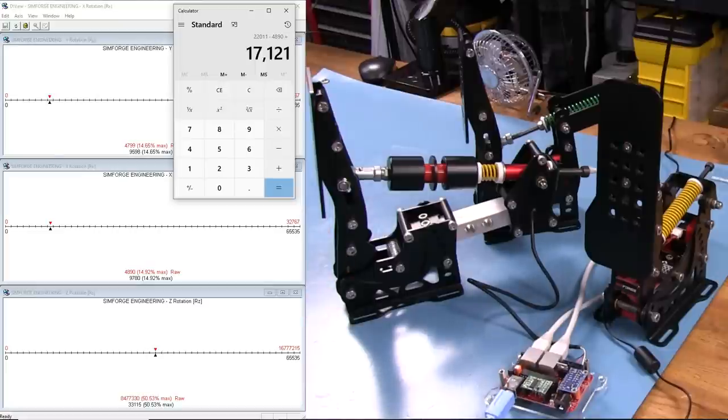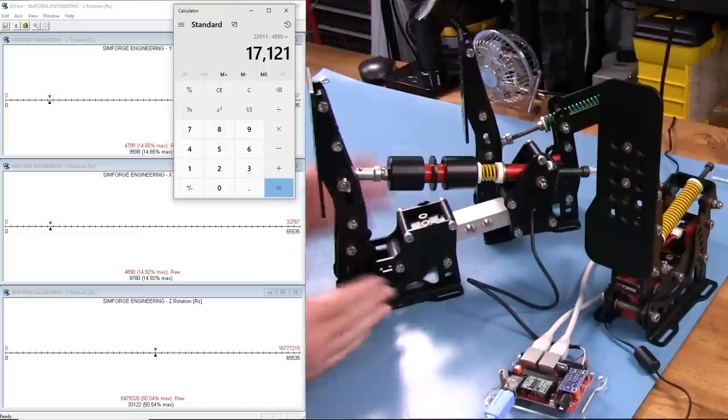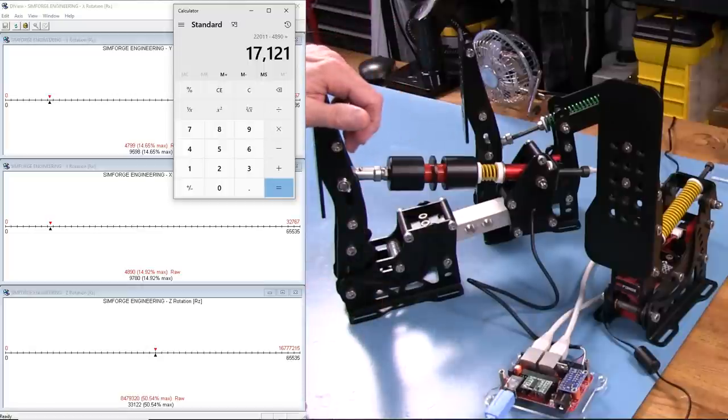Now I'm just going to get everything set up. I'm going to drive it and make some comments about it then. And I'll tell you if anything changed or made any big difference as far as the EMI interference. I'm sure it will once I'm over there as far as DIView goes. But we'll also see if we're getting 24 bits out of the brake pedal. I can't push the brake pedal far enough now to get that number because it's on the bench. But once it's securely mounted, I'll be able to push it and get the full resolution out of it. So now we'll go ahead and get all this kit mounted to the rig.